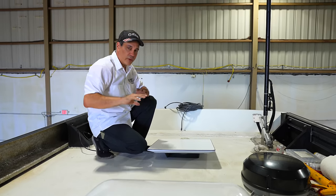We've got the wires run. We had to do it different ways because of the connector ends — this one's going to the back Starlink. We're going to mount this wire up off the ground with wire ties screwed in, then wire tie it all the way down to the back of the coach underneath. I don't want these on the ground — I want water to be able to run off into the drains. For the new high performance unit's cable, we'll keep it just slightly off the ground and Dicor it in. The 50 feet of extra cable we're going to coil up inside the ceiling cavity — plenty of room in there.